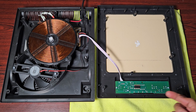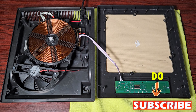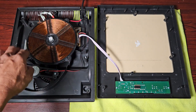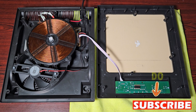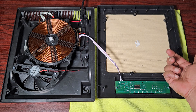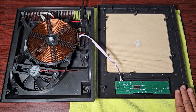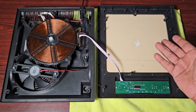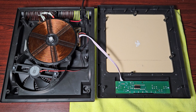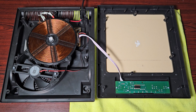This is the control panel — all the switches you see on top. The circuit is for maintaining the temperature, the modes, and various settings. There's a fan here which drives out all the hot air from inside. There's heat generated by the operation of the circuit and also heat penetrating from the hot base of the pot. So this stove does not involve generating heat and then transferring it to the pot — it actually generates the heat in the pot itself. The magnetic field from the coil is involved in electromagnetic induction that induces eddy currents in the base of the metal pot.